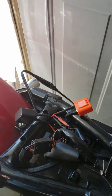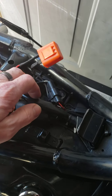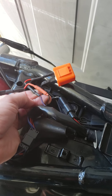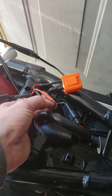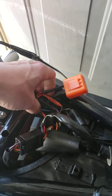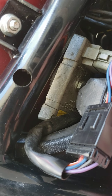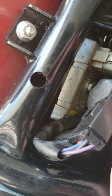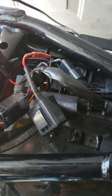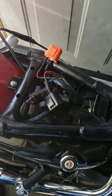The relays have a little adjustment on the bottom so you can change the blink speed. I'm not really sure entirely why you have to do this — you can research it if you want to know. But essentially, you're just splicing these into the brown and the purple wires coming out of your wire loom, then going to the little box. I can adjust them so they'll actually blink properly.